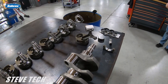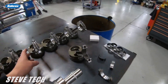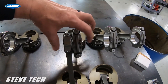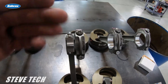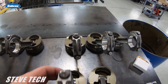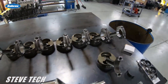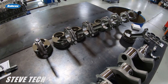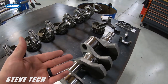What does excessive oil bearing clearance do? Not much really. What you end up with is lower oil pressure, because it's primarily squirting out between the rod and out on the outside cheeks of the rod. All of this creates more windage, lowering your oil pressure. If you have enough oil pump it's not a big deal outside of windage, but in big pro-modified stuff where we have a lot of clearance, it's throwing a lot of oil around.